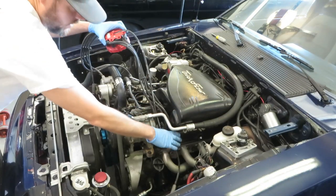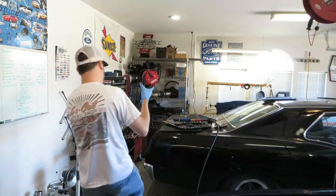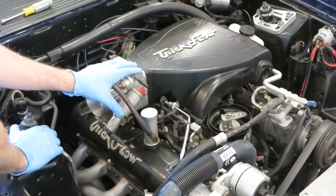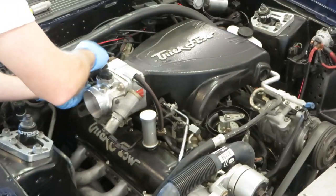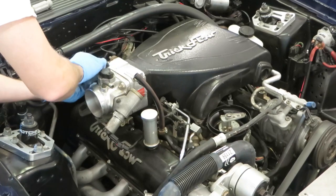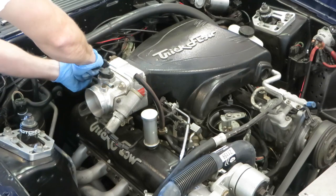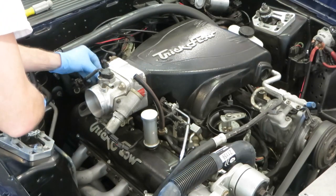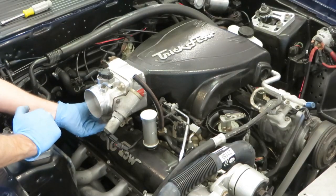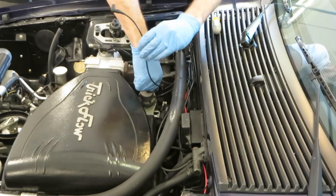Next, I do have to go ahead and remove the mass airflow sensor and the intake tube because it's no longer needed as I'm using the Megasquirt ECU anyways. Go ahead and unplug the IAC, TPS, and all the crankcase oil vent tube and all the vacuum lines. Be gentle with the vacuum lines though because these are old and brittle. Note that your intake does have vacuum lines coming out of it, so go ahead and just kind of pull those off gently. Make sure you release everything connected to your intake before you lift it off.